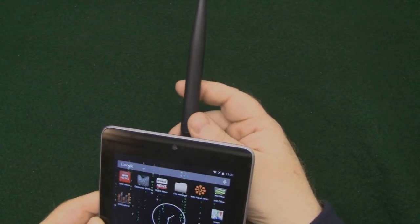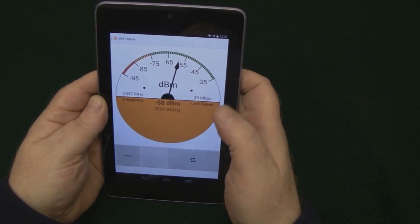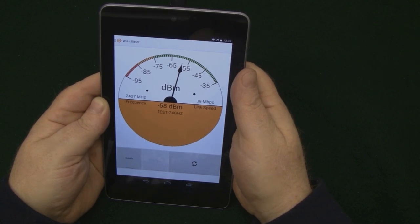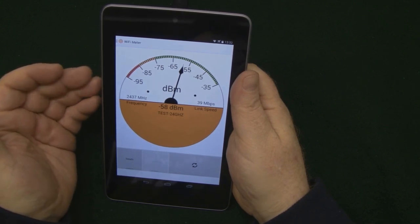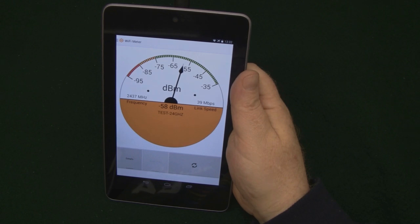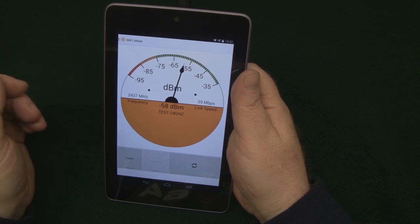The Nexus is back together with a dipole antenna on the back. Scanning now — we're in the green and still climbing. That's a big improvement. With the SMA connector fitted we can now swap in a range of different antennas. I hope you found that useful — please give it a thumbs up. In the next video I'll show a second method to mod the Nexus 7 antenna without anything protruding from the back, by fitting an internal bi-quad antenna to improve range even further.